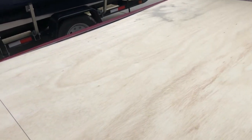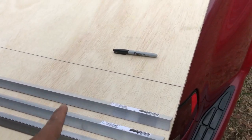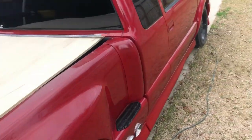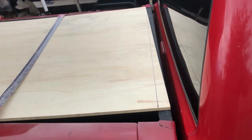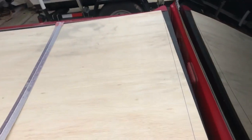You'll need some vinyl, or if you can fiberglass and paint it, that's up to you. So where it sits right now, my bed is wider in the front and narrower in the rear, so you can't fit a 4x8 sheet without having two corner gaps. This piece of plywood is slightly angled and I already got my cut lines drawn, because I figured it's better to have one added section instead of two small added sections.